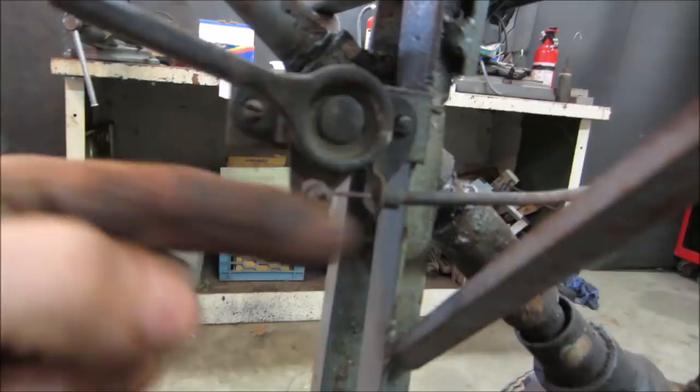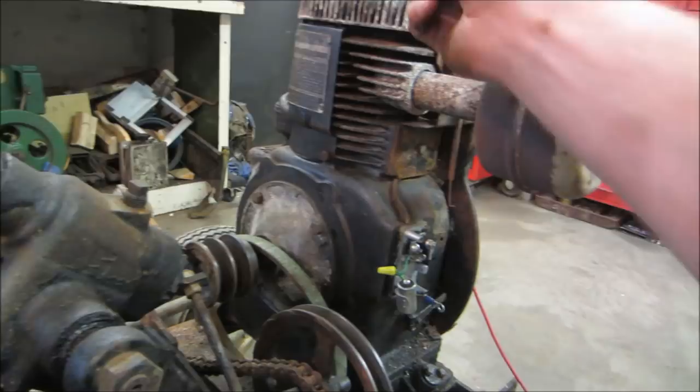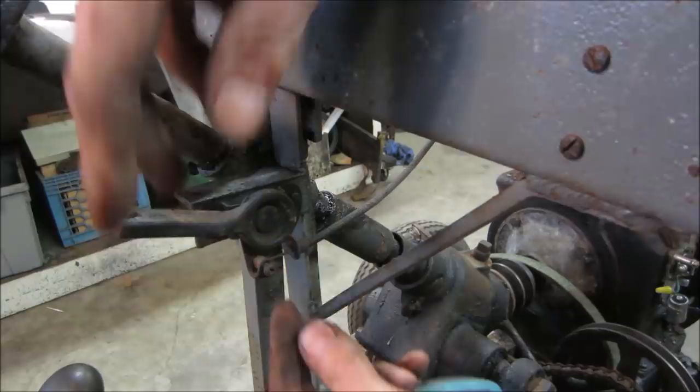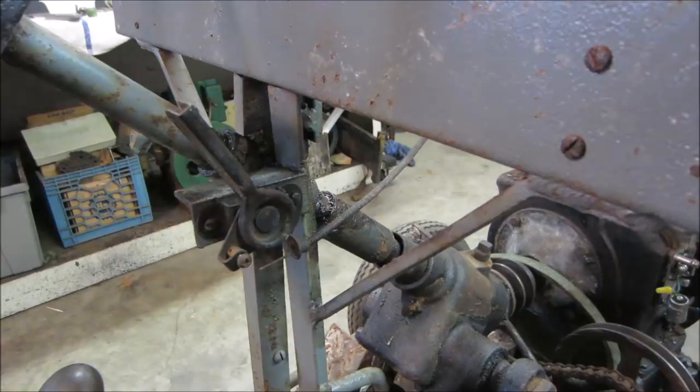And that's the case. We should be able to put vice grips on this side. Kind of tap down, pull it out. We'll clean it up with a wire wheel and shoot some lube through. See if we can get that cable to recover. If not, we'll go find something else. See, I should be able to pull that lever right up off of it. There we go. Yeah, it's a straight shot. All right, let's go. Give it a tug.